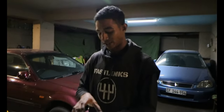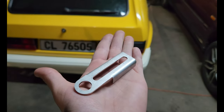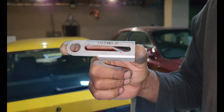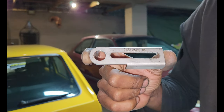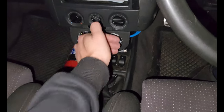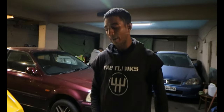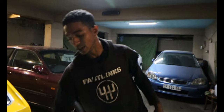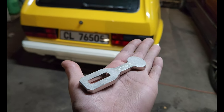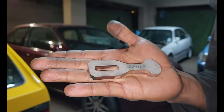Here are our parts. Starting with the Golf stuff — this is the short shifter that we put on the Golfs. It basically shortens the throw, the forward-backward movement, so that your hand doesn't go too far forward or backward. It's more than just a racing modification — it actually makes the car feel a lot more modern, and it requires less effort in the shoulder and elbow so it's more in the wrist. Then this is the steel lollipop to eliminate the standard rubber lollipop where the ball usually wears out — ours is a full steel version and it's also adjustable.